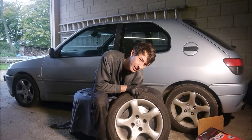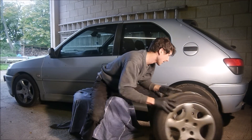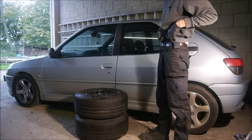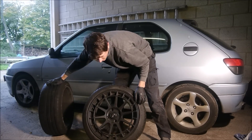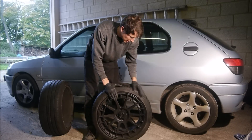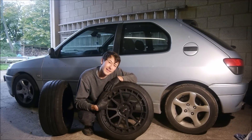Need to go bigger. 16-inch is not big enough — going to need 17. I'm not a great fan of 17-inch wheels; there are very few that I think are nice. But this is what I got — a set of Rota Recce wheels. That's how you say it. 17-inch, 8 inches wide, ET40, and 108 PCD.